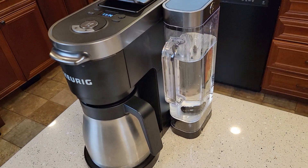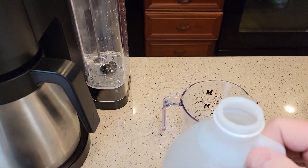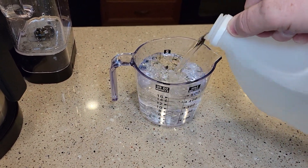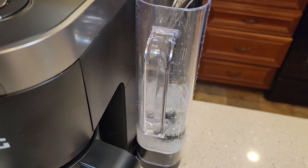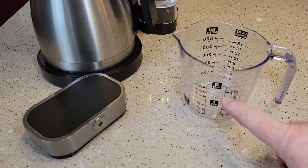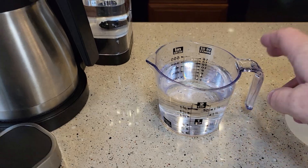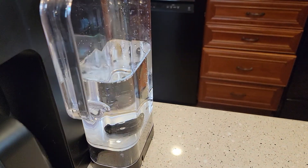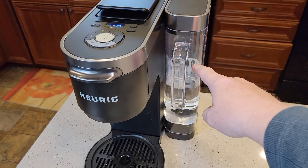I'm going to empty this out and put in our vinegar. You don't necessarily need a measuring cup but I'll show you where it ends up on the reservoir. We're not going to fill the whole thing with vinegar — I'm going to put in 14 ounces of pure white vinegar, then another 14 ounces of water, which is roughly close to two cups. With the water and vinegar in there it comes up almost to the sixth mark, just about to the bottom of the handle.